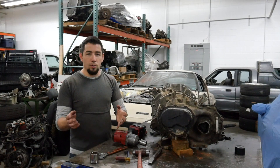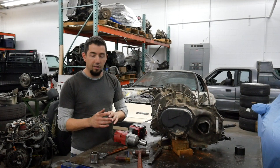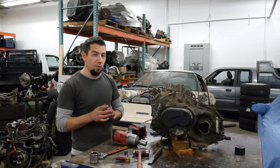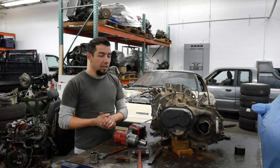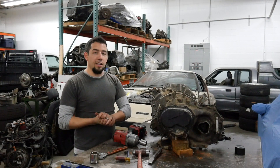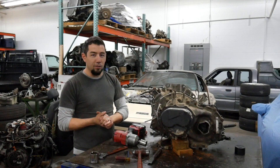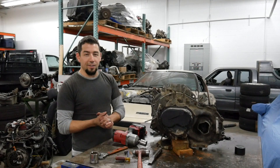But if you wanted to change the gear ratio, you can do that as long as you stay within the same type of transmission — the process is the same. Make sure you're not driving with your hand on the shifter — that's what wears this out. And make sure you have the proper fluid level. Those two things will greatly increase the life of your transmission. Subscribe for more videos on front wheel drive Mazda stuff, and I'll talk to you guys later.